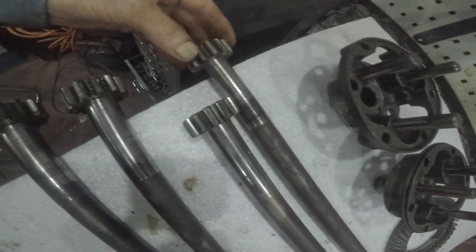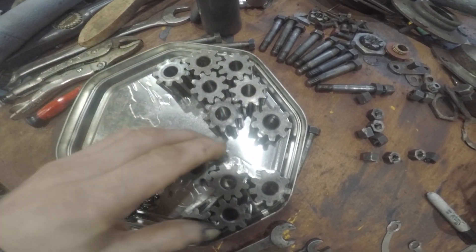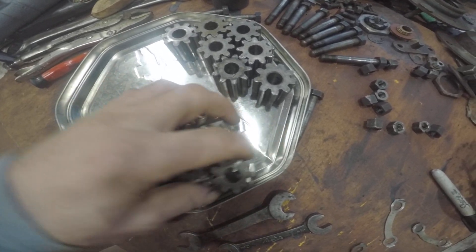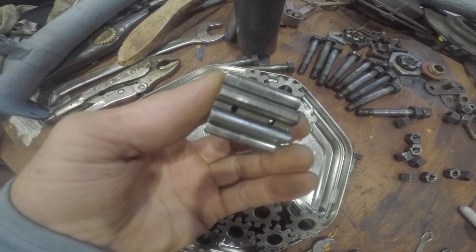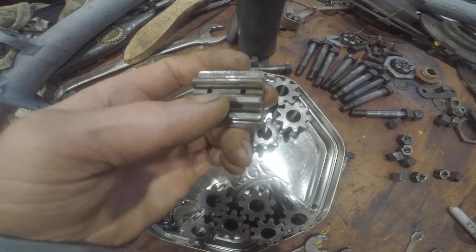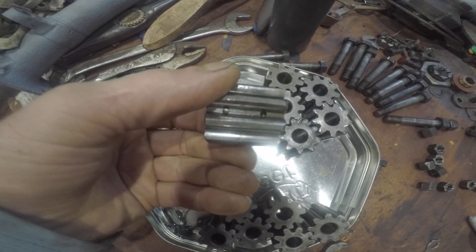This carrier's OK. These are all the differential gears. I picked and chose the best ones — the best ones have already gone into that differential. These are the second best ones, and those are the worst ones. You can check those when you take them apart — that one's got some corrosion on it. When you clean these, you want to check the little oil holes there, just to make sure they're clear so you get some oil down onto the shafts.